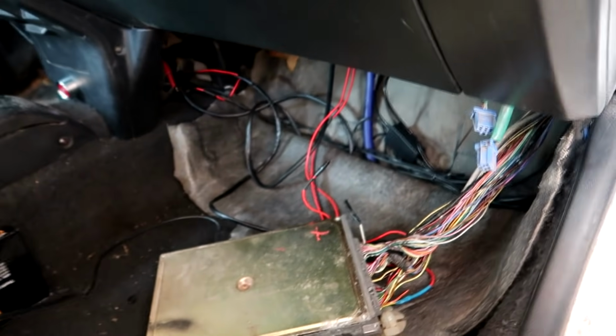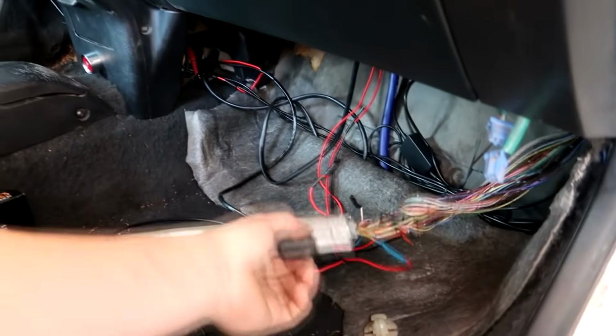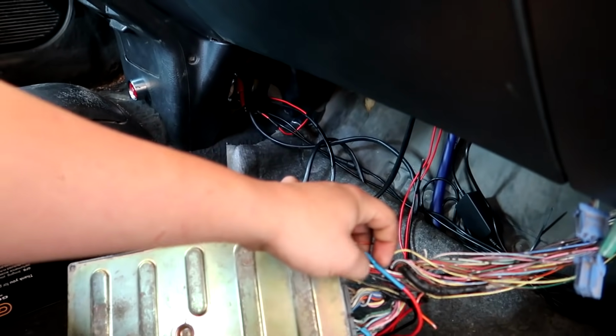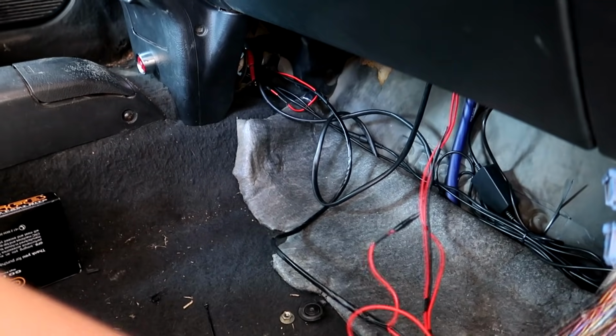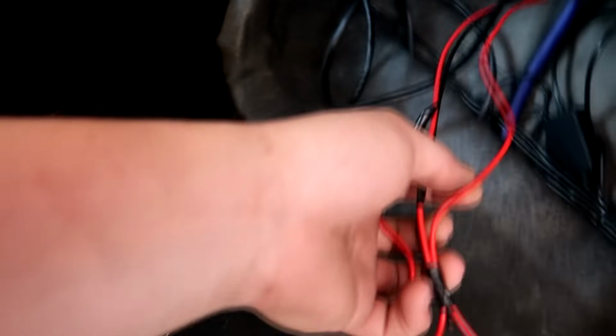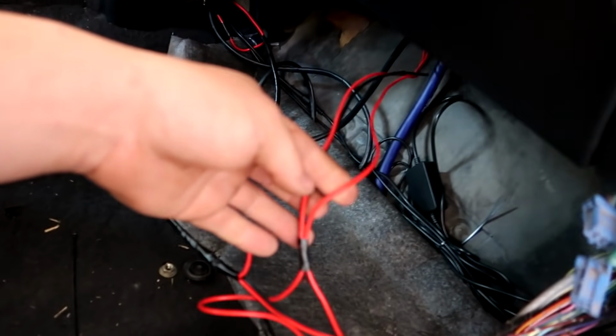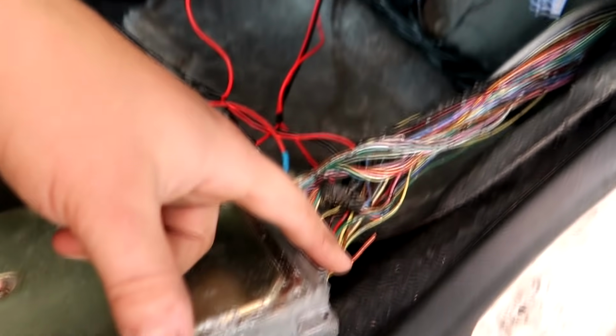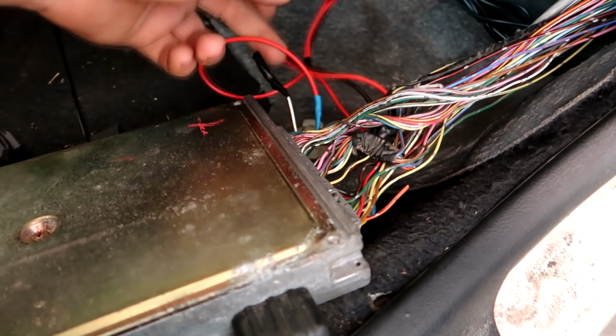So I went in here and I checked some of the wiring out, and I'm gonna redo the VTEC wiring how I would do it, because the way they have it is they have A4 coming out, going into this bundle of red wires, and the red wire is going out into the engine bay. I don't know exactly what wire is what out there, so I may have to check to verify that the one coming out of A4 on the ECU is actually going to the solenoid.